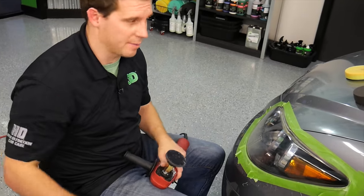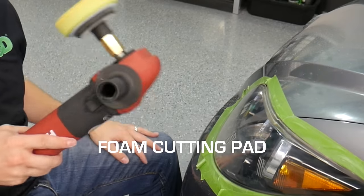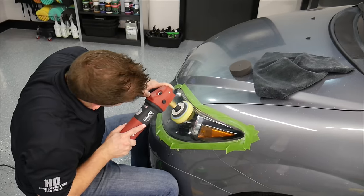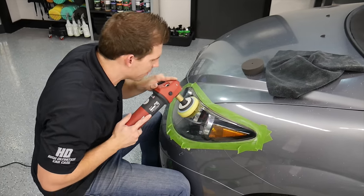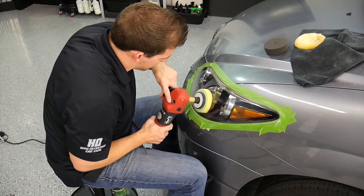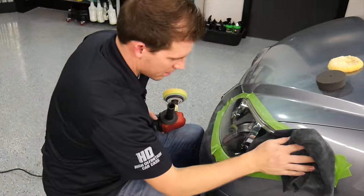What you're going to want to do is take a foam pad — possibly go with the cutting pad, depending on what damage was done to the headlight before. Put on your foam pad and work it into the surface. Foam pads run a lot hotter than wool pads, so you've got to make sure you pay attention to that. You're going to start brightening out all the dull stuff that was left over from the wool pads. Depending on the amount of pickiness you have, this may be your final step. But because we're picky and want to make sure it's done right, we're going to do one more step. I'm going to wipe down the compound.